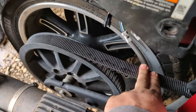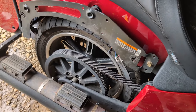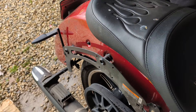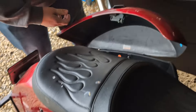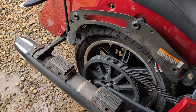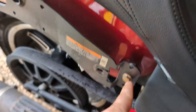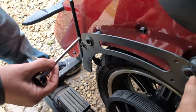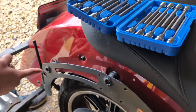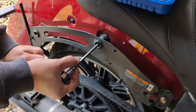I was just checking the tension on the belt. These are Allen heads, six millimeter. You have two of these and then one, two, and three here. These look like 10 millimeters. I'm going to say take the actual saddlebag mounting plate off first.